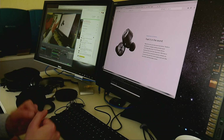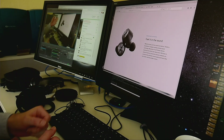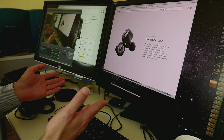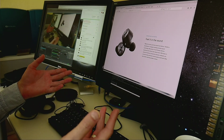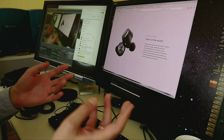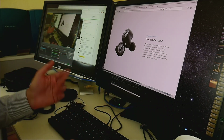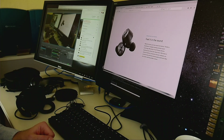Is this really more amazing than, you know, our previous generation, which had better audio quality than the Bluetooth compressed stuff? And again, this Bluetooth compressed stuff is recompressed, right? You don't have compression artifacts from your purchased music, plus, well, that you are probably usually not able to hear, but theoretically they are there. There is something lost theoretically, even though psychoacoustically you usually can't hear it. But additionally, it is recompressed, so then you have twice the artifacts, obviously, especially over SBC. Certainly apt-X and AAC are better.